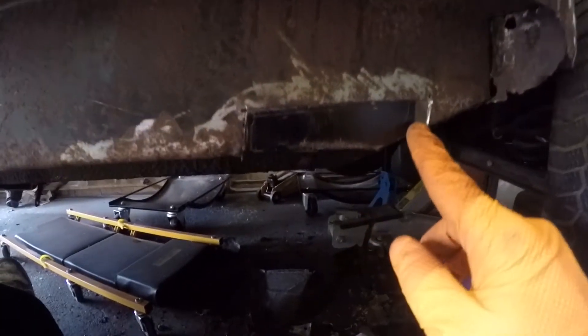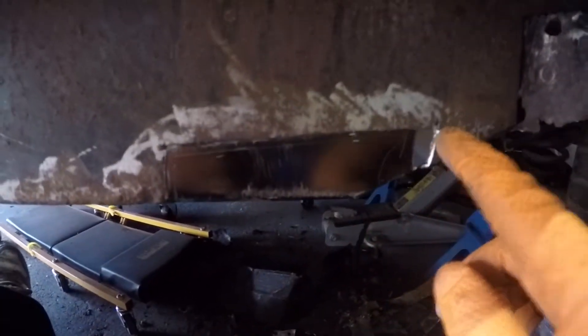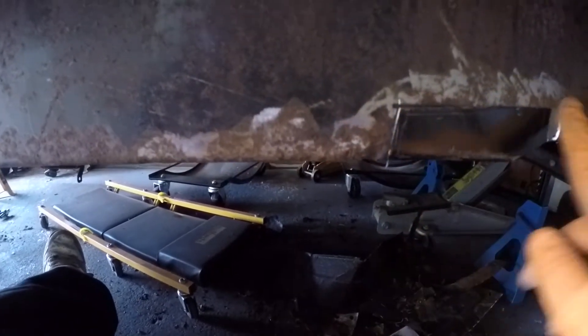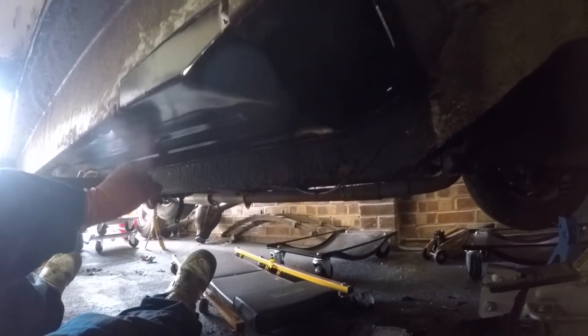I'll tap this one in as well, but as you can see there's a tiny gap. This one really fits nicely in, so it forms a very nice patch. And then underneath here there's a gap, but that's where you put the spot welds — you drill the holes in and it forms a nice bond when you weld it.